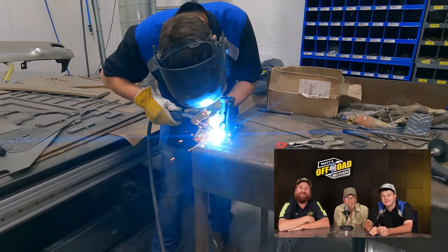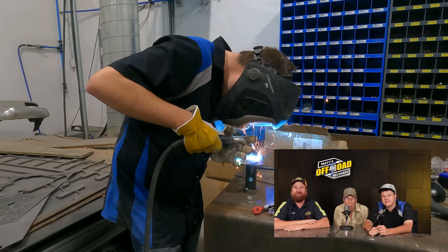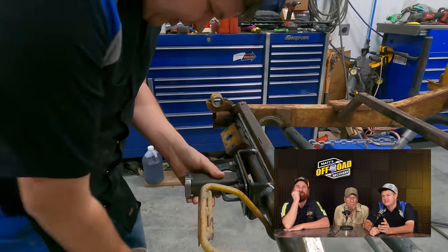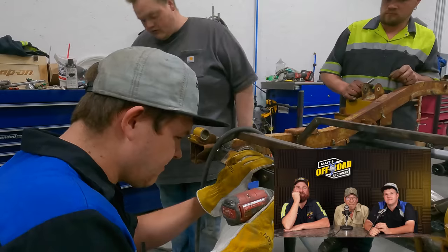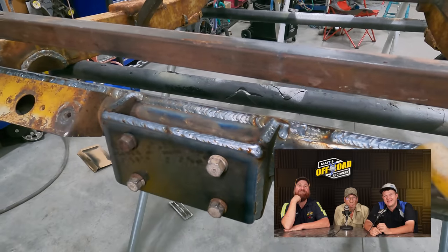It had like a D-ring before — but now you've got a hitch. Got the top all welded, now I'm just going to burn in the bottom. I got scalded by the internet for quenching that. That doesn't hurt regular metal — it's not tempered, just mild steel. Tempered metal — that ain't going nowhere.